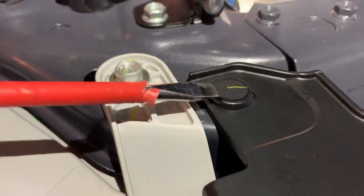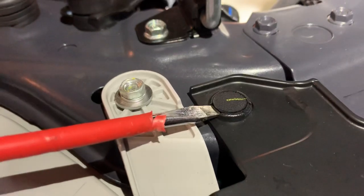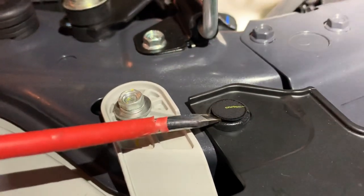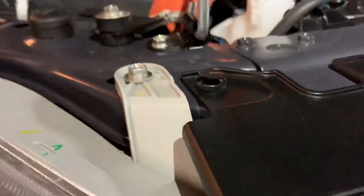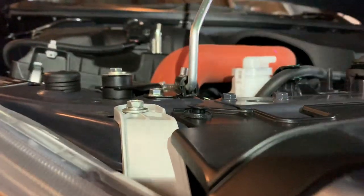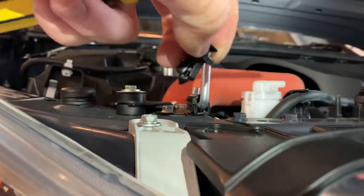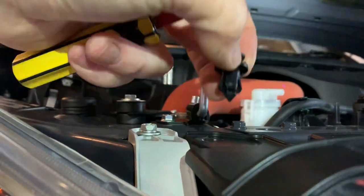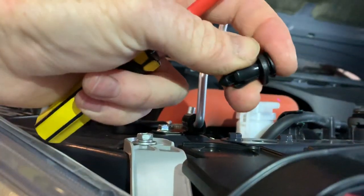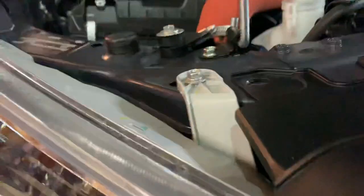You can see the clip has three notches around the side. If you just get your screwdriver under one of these notches, you'll get that centerpiece to pop up in the air like so. Now that's popped up, you can actually pull that whole clip out. To reinsert it, leave it in the up position, put it back in the hole, and simply push it back down flush — that locks it in.